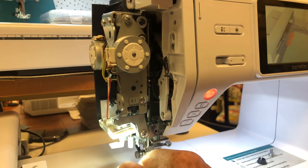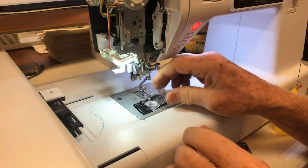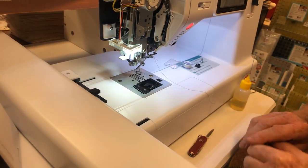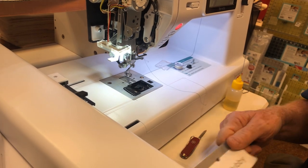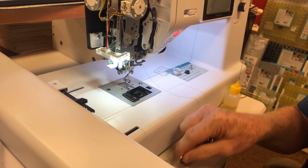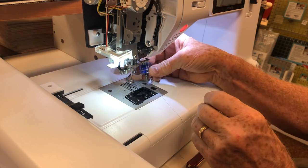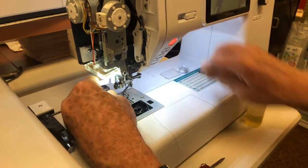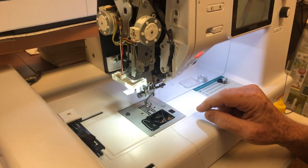While we're at it, we're going to open up the bottom hook area — take the needle plate off and clean and oil there. So we'll take the cover off and the bobbin out. They give you a tool to take the screws off the needle plate. I also sell these tools, called flattened stubbies — they're five dollars plus three dollars shipping. Take the little storage screw out of the end, which makes it a lot easier to use. Now I'm going to take the two screws out of the needle plate.